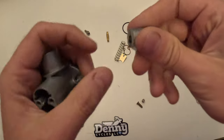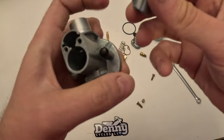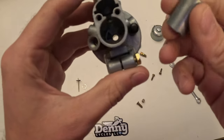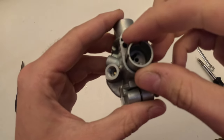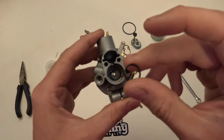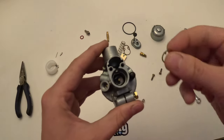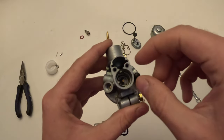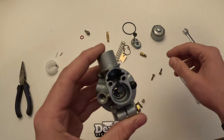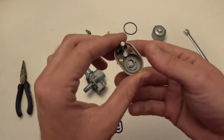Now we're going to get to reassembly, and we're going to start with the slide first. Notice there's a little groove in it and a little pin on the inside of the carburetor body — that's what the slide goes onto. It goes on like this, and then the needle and clip goes straight down. You want to make sure you get it lined up, and then that top clip just goes right on top. That top clip is called the idle slide top clip.